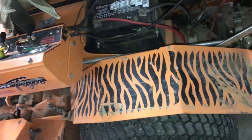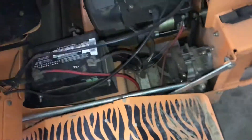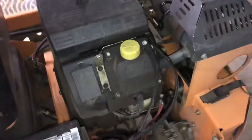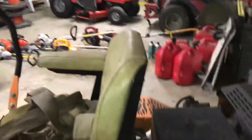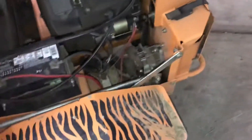It's working now. Another thing — if the Tiger is not starting, look back in here because there's the starter motor. If that blue wire has come disconnected, pop it back in and try again; that should fire it up. That's all for now guys — the Ferris and the Simplicity are working just fine and we're hopefully going to get a permanent fix on this. Just thought I'd show you a temporary redneck fix — safe going guys.